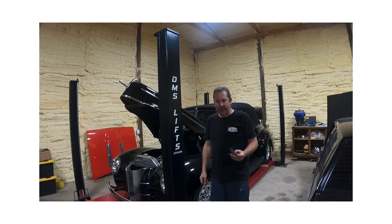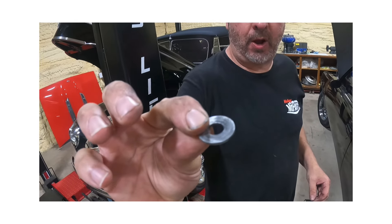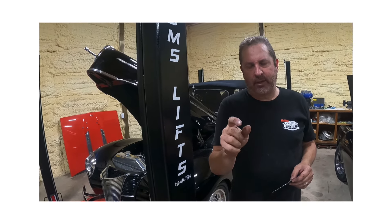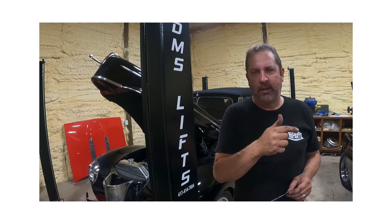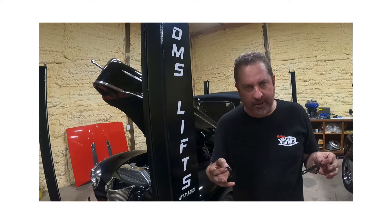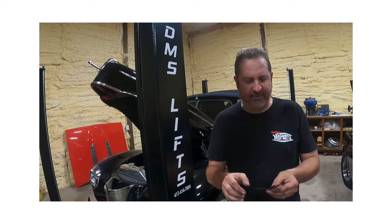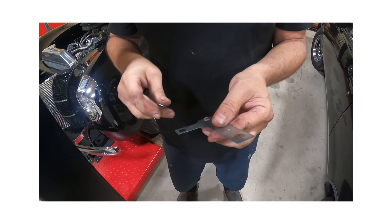That concludes it. We got our starter in and didn't need to use any shims at all — when we took the original starter out, they had washers on there that shimmed that starter way down. A couple things I learned from the instructions: the pinion only needs to engage the flex plate or flywheel 50% to 75%. It doesn't have to come all the way out because it has to return. Got the starter installed, used our 30-thousandths paper clip, and it's on the money. Some of these GM engines you will have to shim them — there are different shim kits, some cut in half, and you can use Oldsmobile/Pontiac ones and just cut them to slide in.